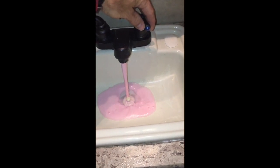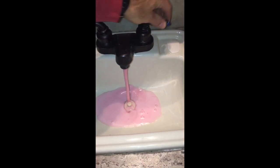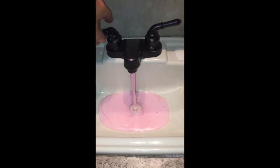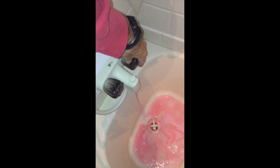Now I'm going to just go open my hot and my cold water on all my faucets till I see the pink antifreeze coming out. And on my toilet and my outside shower. And if you have an outside sink, don't forget that. I forgot that the first year and I had to end up buying myself a new faucet.